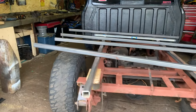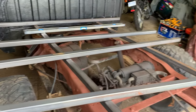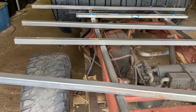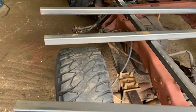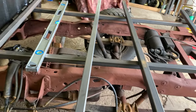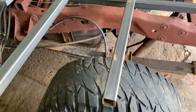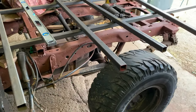Hey guys, welcome back to the channel here at Muddy Thumper. We're going to start the flatbed build — the truck is up and running again. I just got some square stock, inch and a half by inch and a half by one eighth. I'm trying to see what height I want, because I'm doing a true flatbed with no wheel wells, so I'm going to need it a bit high off the top of the tires — probably about a four inch lift for the frame so the weight doesn't sit too close to the tires.